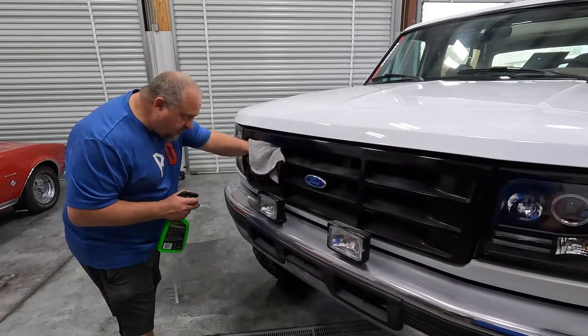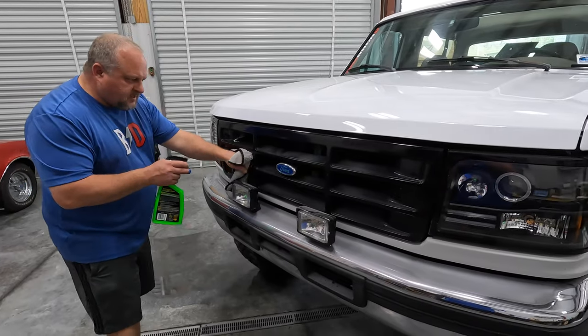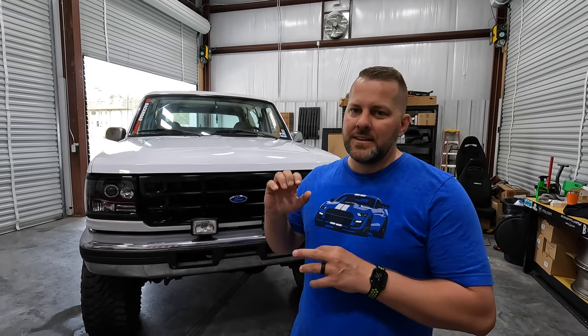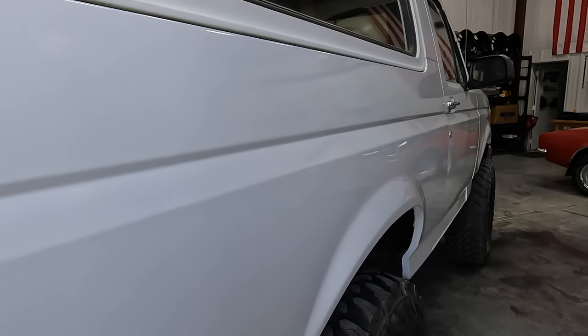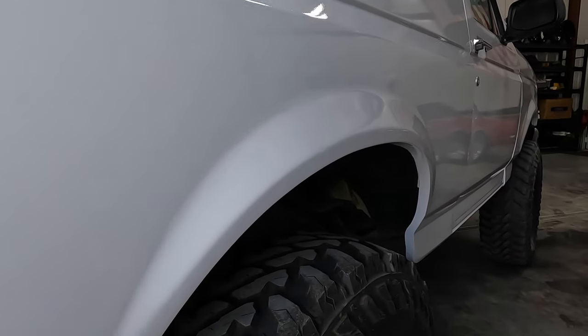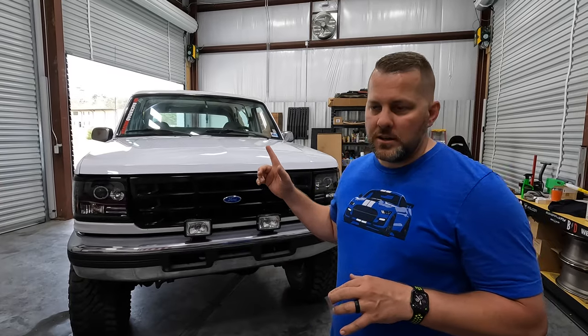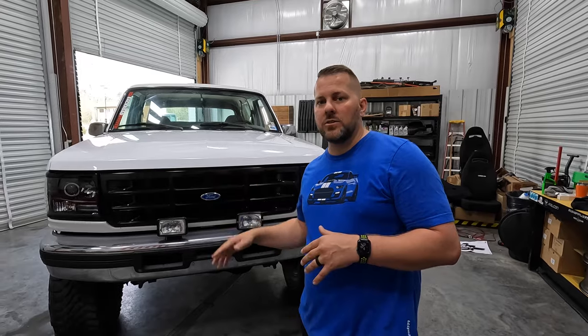Quick disclaimer — it's not completely finished. They need to let the clear coat cure for two or three days; we may even let it cure a week before they start wet sanding and polishing, so it's going to shine even more than it does right now. It looks totally different than it did. They ended up painting a lot more than they thought they would — had enough paint, so they just kept going. They put four coats of clear on there, so it's a really thick clear they'll be able to cut into and get really smooth.